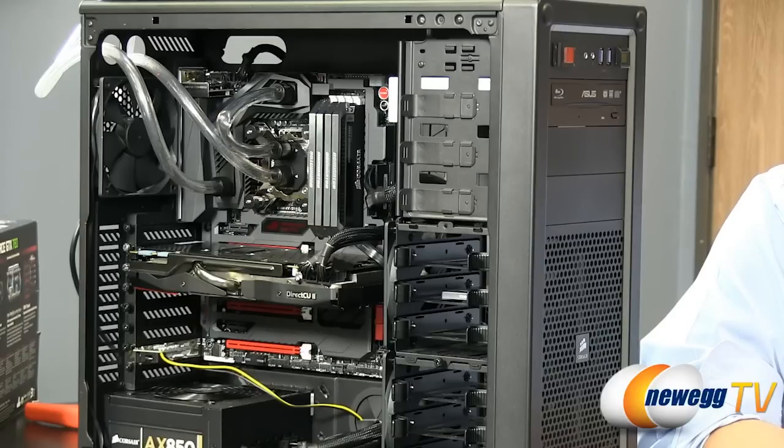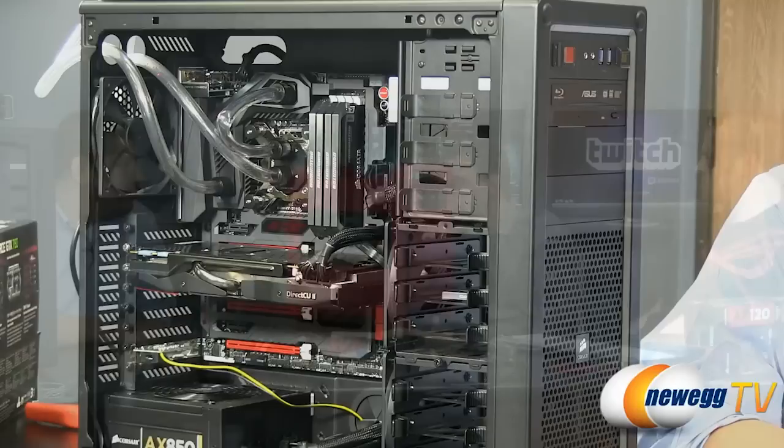Let's see, I guess this is sort of for both you guys. With the AHCI topic, what if I have 2 hard drives in RAID and 1 SSD, and my motherboard can't enable both modes, AHCI and RAID mode? What do I do then? I've been using RAID mode. I usually use just AHCI. Use RAID mode. Yeah, that's okay. Really? Yeah. RAID supports the AHCI protocol in terms of the transmission. So you will still maintain the benefits as long as you make sure you have the RST driver console installed. You will be able to make sure that that single drive is operating in AHCI mode.